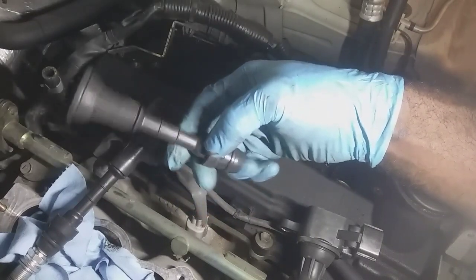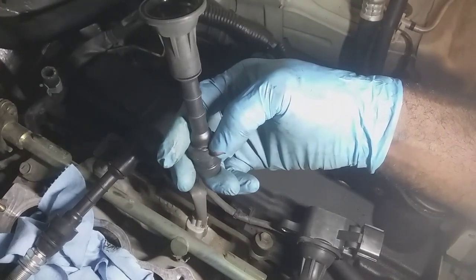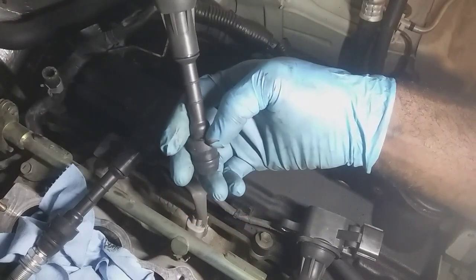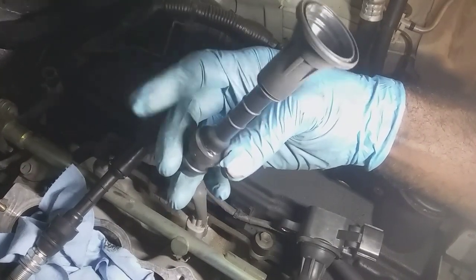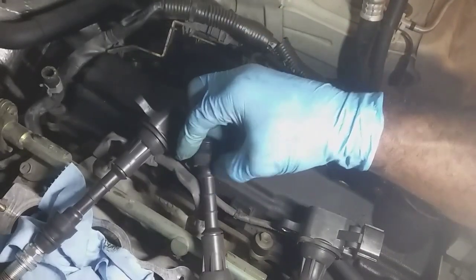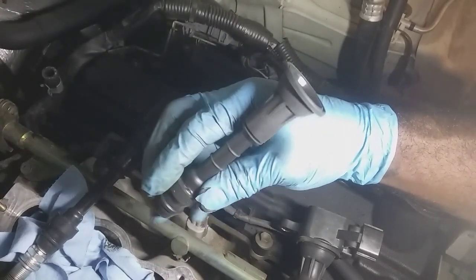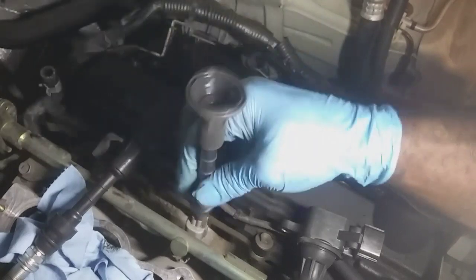With the air-fuel ratio sensor, the numbers will drop, indicating a rich mixture, which displayed in about 40 millivolts, dropping down in some instances to 95 millivolts versus the 1.45 volts at normal idling conditions. So that pointed to bank 2. We're on bank 2, and being able to just kind of overlook the boot here, once I pulled it back out and started to re-inspect them, I saw that little white pit there, and this is just classic.